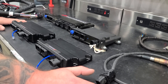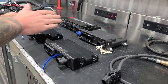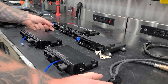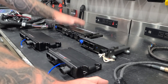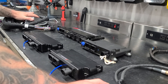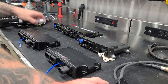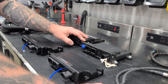So you can wire the car up and spend the first three, four, six months — or even a year — on a Terminator X. Then when you decide you want to change over from gasoline to alcohol, or go to a Dominator for more control, you remove the Terminator X, plug the Dominator in, and it will fire up and run using all the existing wiring harnesses already in the car. You'll just have to change your O2 sensor. Hopefully that answers the questions about the wiring harnesses — they all work with all of these ECUs, same thing with the power cable.